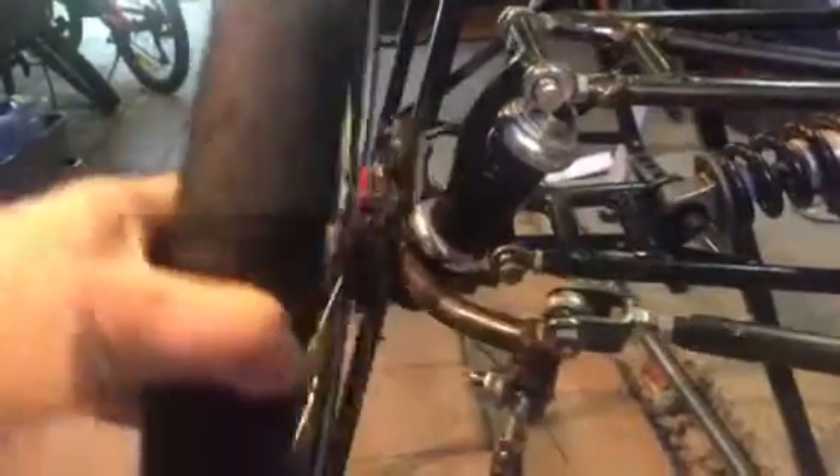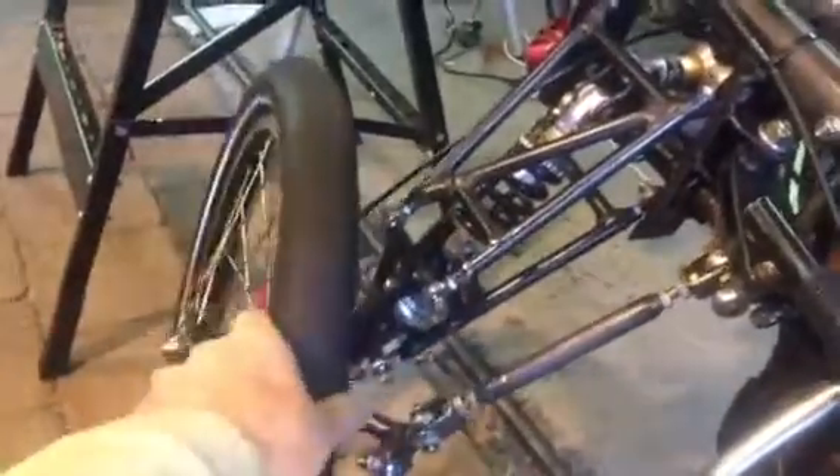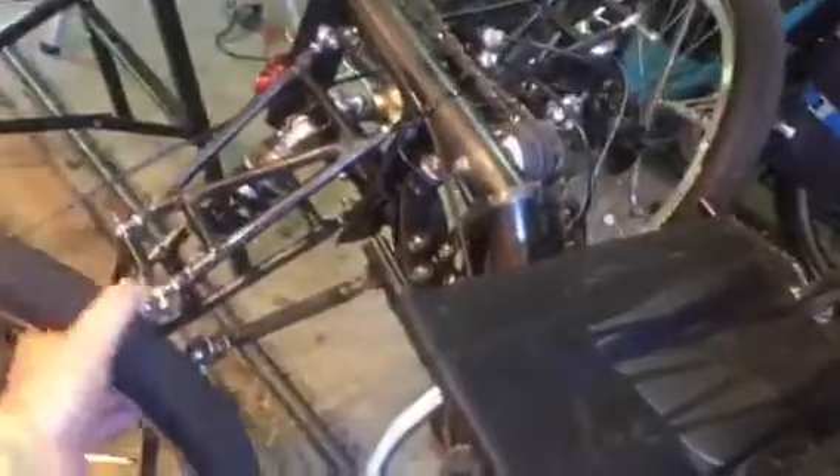When I bring the wheel up to level, you can see that the kingpin axis of rotation of that front wheel is much closer to vertical, and if I bring it up to this level of tilt it's nice and perpendicular. However, when I move the angle of tilt down, it's at this point that the steering tie rod angle becomes problematic, where this wheel can flop around completely independent of the other wheel — which is not good.